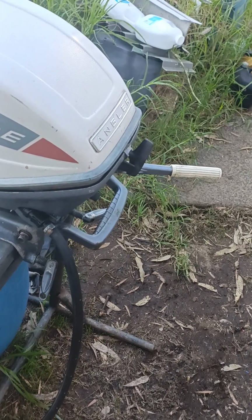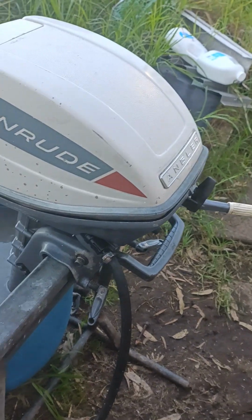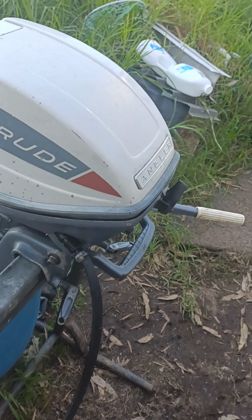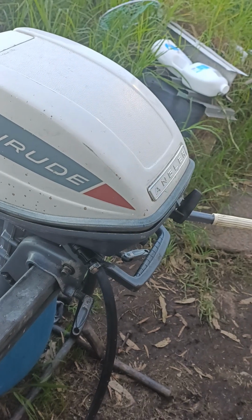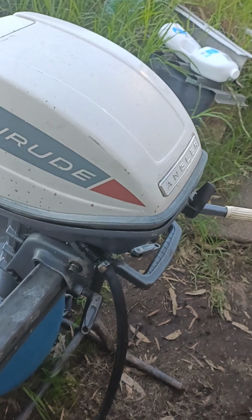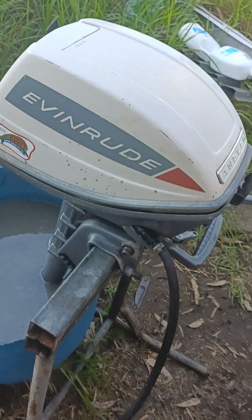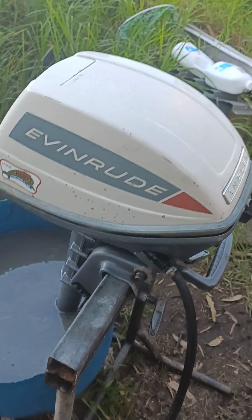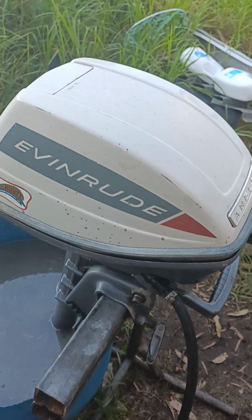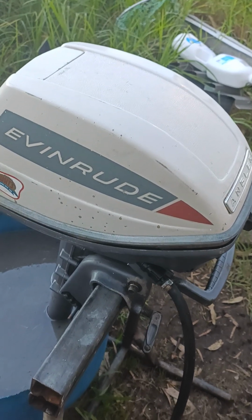This one, I went right through it. It's had all the usual tune-up stuff. First, it's had the points reset, and everything cleaned up in the magneto. I wanted to make a first-class job of this one, so I even replaced the spark plug wires. These are originally fitted with solid wire core, so I had to chase up some solid core ignition lead.